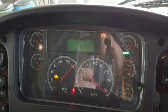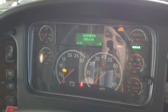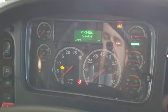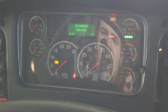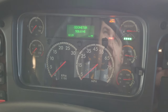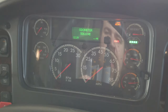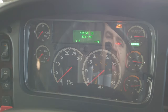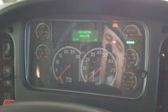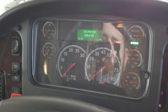When you go to start your coach and pretty much any diesel operated vehicle, you want to turn the key over and let all the gauges sweep. In colder weather there's actually a preheat lamp that comes on, which means it's preheating the air and the air intake — you want to wait for that light to go off before trying to start the motor. It'll start a lot easier with warm air going into the motor. It's beeping at me because the levelers are down, so it's saying do not drive anywhere.